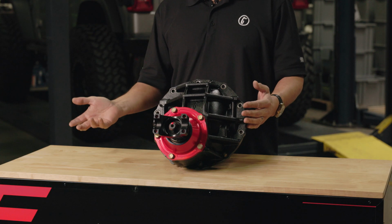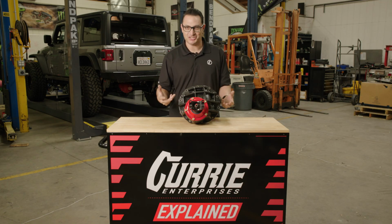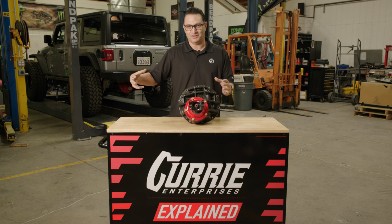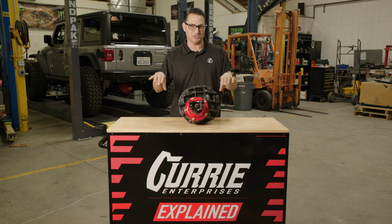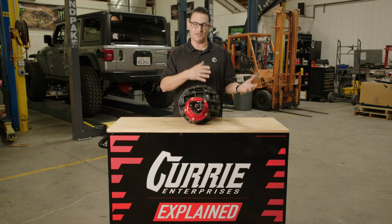When do you need to go up to 35 spline? If you're drag racing and making a lot of traction, what's happening out on that tire is it's gripping the ground and it's twisting up that axle shaft. Well, the larger the diameter of the axle shaft, the more of that twisting force it can put up with. That's when we want to go and upgrade to 35 spline.